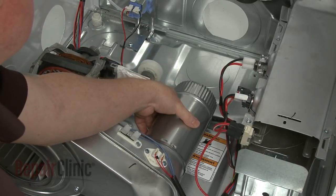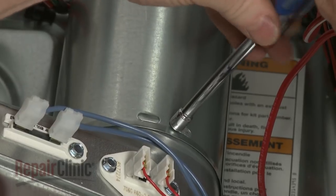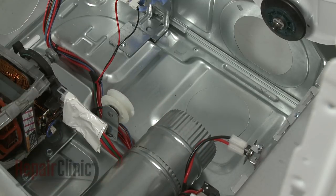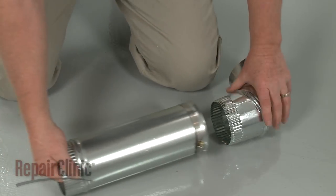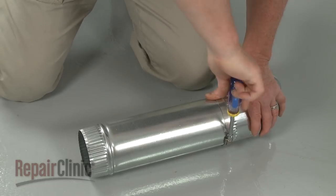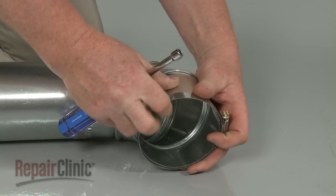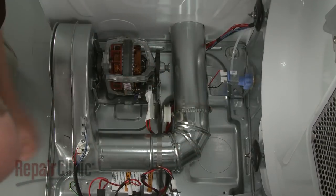Next, attach the medium-sized vent piece from the kit to the blower housing and secure the vent with the screw. If exhausting through the dryer base, you will need to add the small extension vent piece in order to align the elbow section with the hole. Insert the elbow section into the long vent and secure with a 4-inch clamp. Place another 4-inch clamp over the end of the elbow section. Now insert the long vent through the hole in the cabinet or base and align the elbow on the vent piece attached to the blower outlet. Tighten the clamp to secure.